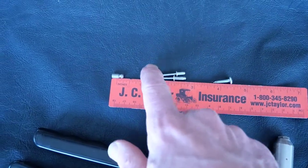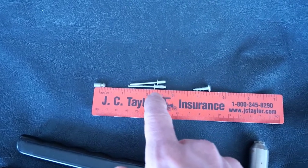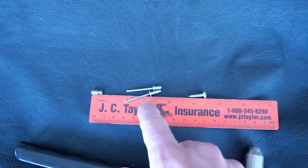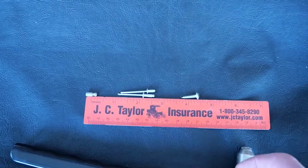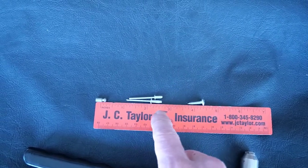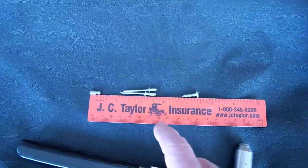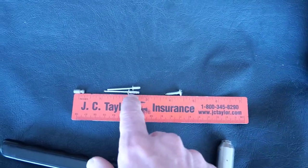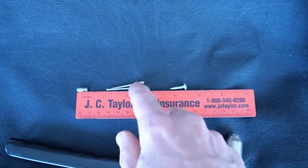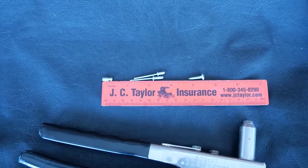That's what you normally do and it gives you more room for the weather seal. There are two types of rivets I'm playing around with — these are eighth-inch rivets, but the shank can be a different length depending on how much material you have. I'm going to use the shortest one, and I'll probably use the longer ones just at the very ends where you have more fabric. These are eighth-inch rivets characterized by the shank — the smaller one is called an eighth-inch and the one in the middle is called a quarter-inch shank. So the eighth-by-eighth rivet will do fine. These are aluminum to make it easy to apply.